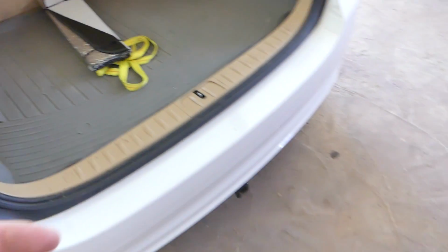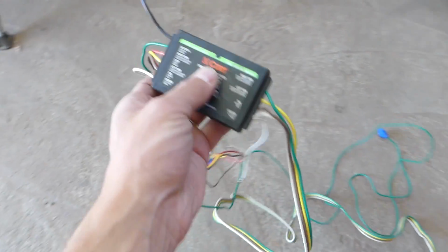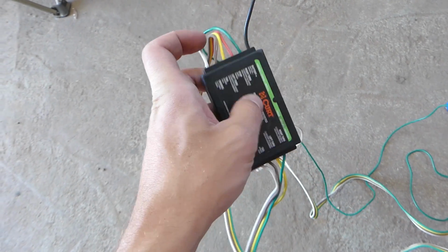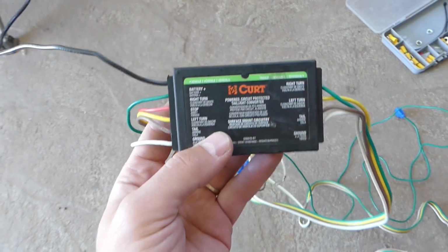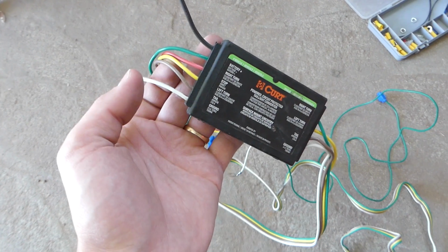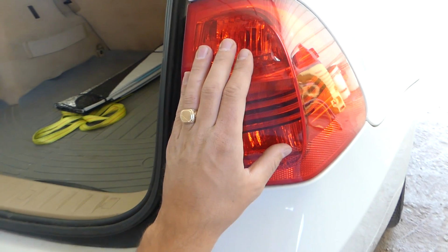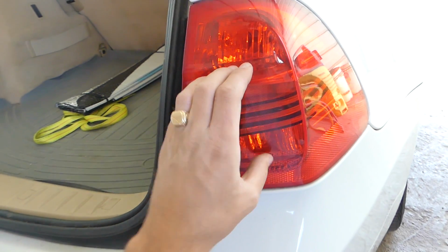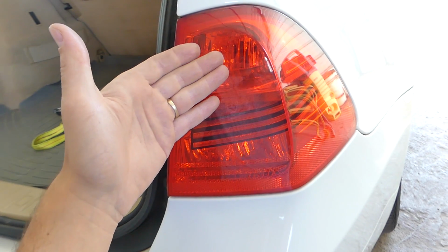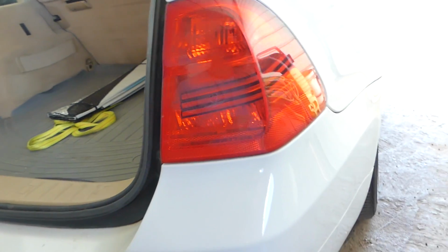You can see ours, we have the hitch installed already, so we need to go ahead and connect the wires. What we'll be using today will be this device right here. We'll have everything that we use listed in the description of the video below. It needs to be the one that's for the German vehicles, or imported vehicles, that have the turn signal bulbs separate from the brake light bulbs. As you know, some American vehicles use the turn signal and the brake light at the same time. The German ones, imported ones, have the turn signal on a separate bulb compared to the brake light, the stop light.